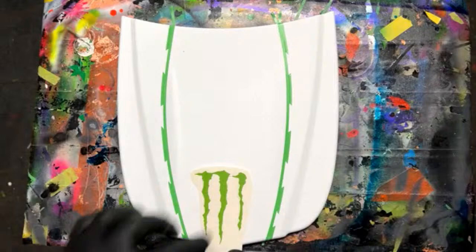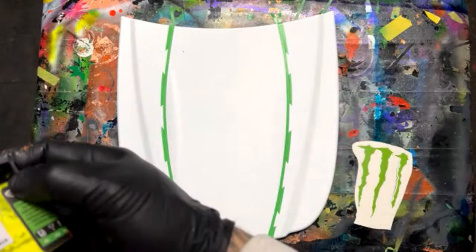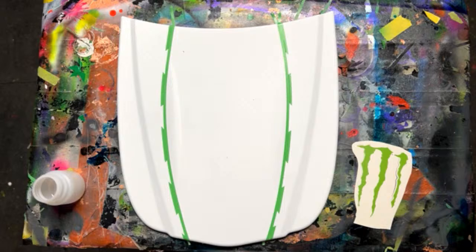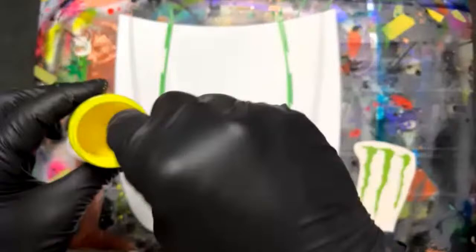So in order to do that, we're going to use a couple of the base coat pigments, the Limeline yellow and the bright green. So we have those two. I have some inner coat clear in these little bottles here, basically clear base coat. It's one scoop per one ounce sprayable, according to the instructions right here. So take a scoop of that. We're not going to have quite one ounce, so we'll do about a half scoop.